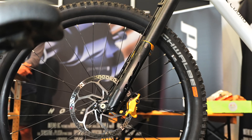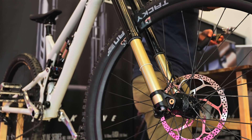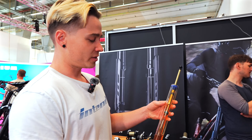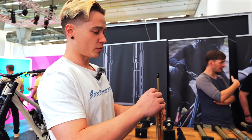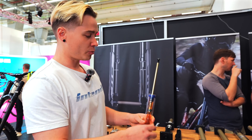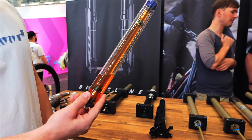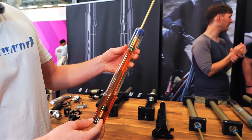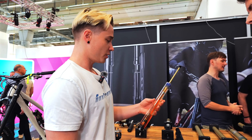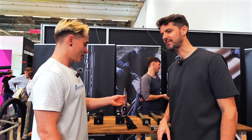It's really easy to service - you don't have the whole CSU unit when you want to do service, you just do one side after another. This is a semi-open bath cartridge - an open bath would have no seals and lubrication equals damping oil, and this is semi-open bath so we have seals. There's regular rebound and compression piston, high-speed compression, high-speed rebound, and low-speed adjusters. It's great to see it with a see-through - it's really cool.